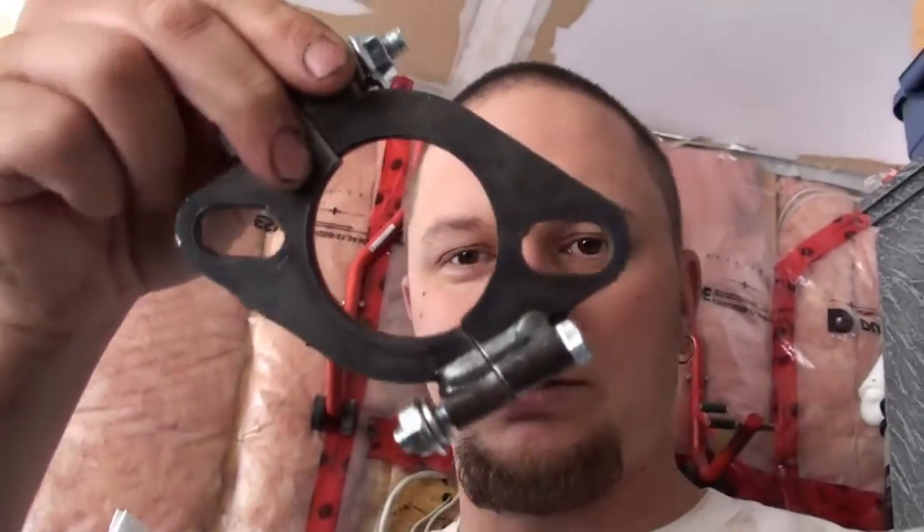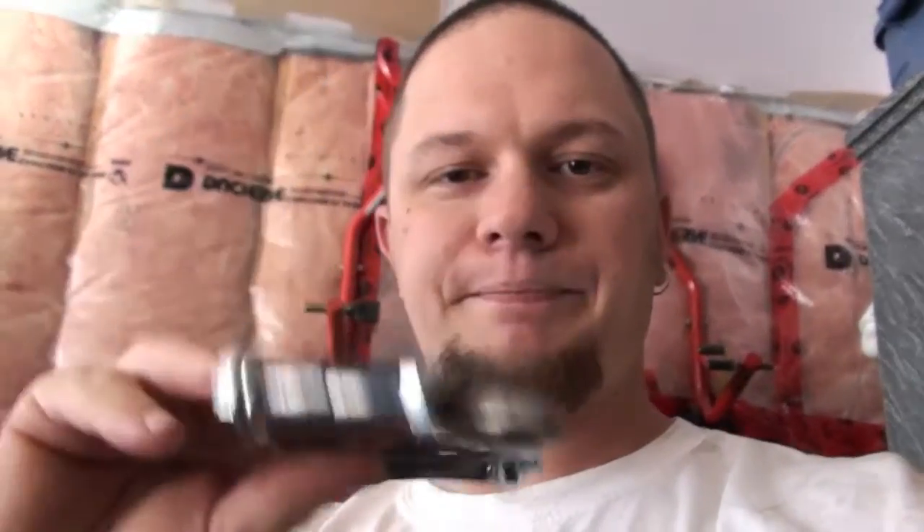For the exhaust — I went down to a local parts store and got myself a two-piece flange, so that's sorted. Unfortunately, they didn't have any spring bolts, so I have to wait until Tuesday for those. I'm just gonna MacGyver something for now so I can connect it, put oil back in the car, and test it out so it's not crazy loud.